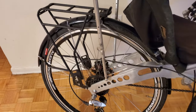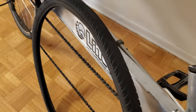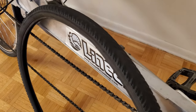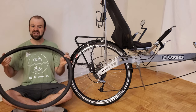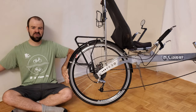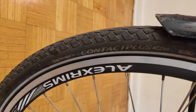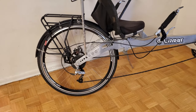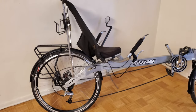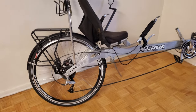So while we're at this end of the bike, let's talk about the rear tire. When I first assembled this bike, I used the tire from my old 700C hybrid bike. This tire already had a lot of distance on it when I installed it, so it didn't take very long for it to start to wear out. Eventually I switched to the matching tire from that same hybrid bike, and when that wore out too, I bought a new tire. The tire I chose is a Continental Contact Plus 700x35C. I chose it because it's got a smooth tread and it's also relatively wide at 35mm. Having a wider rear tire kind of acts like a suspension, which is important when you're riding a recumbent bike because you stay seated 100% of the time and it's really nice to have the tire soaking up some of the bumps rather than your spine.